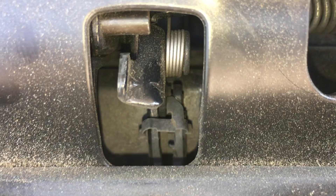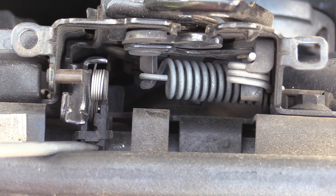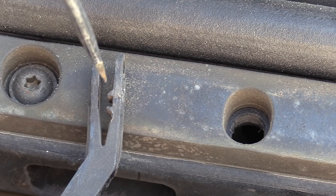While you're doing this job, you're going to be working in this small opening. I went ahead and removed the cover so you can see what I'm doing better. With our long flat blade screwdriver, start by lifting up on the metal retention clip. After the clip is out of the way, insert the screwdriver between the two tabs of the plastic hood pull. Rotate the screwdriver slightly so that it opens wide enough to clear the metal pin that holds it in place.